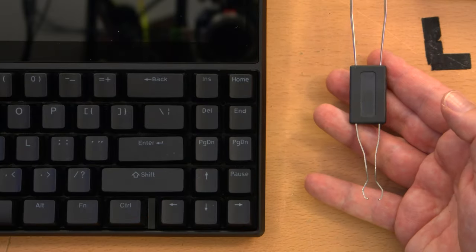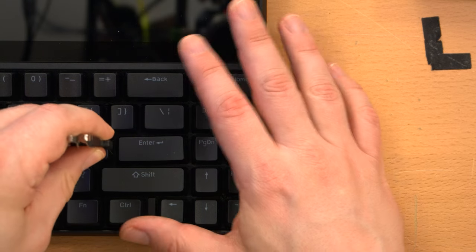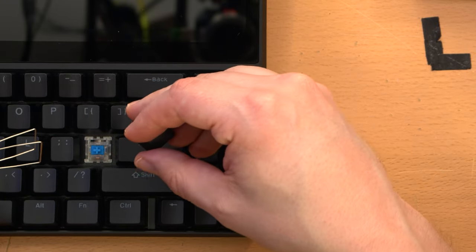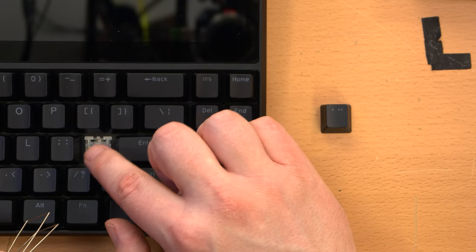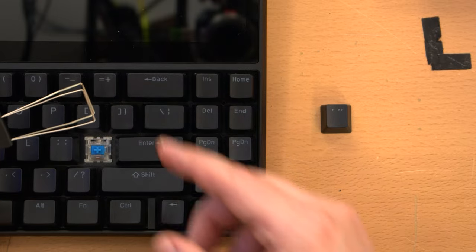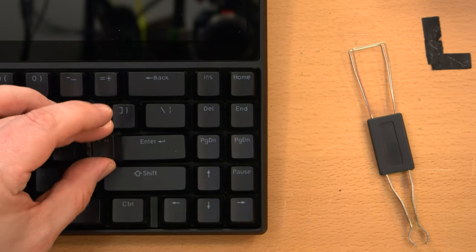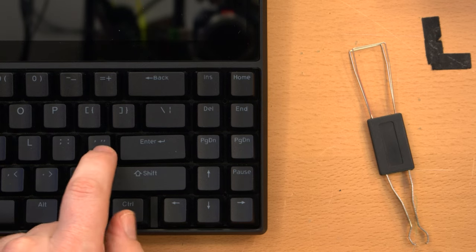Speaking of the keys, it did come with a key-cap puller, which is convenient if you're going to be swapping out any of the key caps or cleaning underneath them. The keyboard has blue switches, which offer a very light clicky feel. To use the puller — it's a very flexible piece of metal shaped to go around the key — you just slip it over the key, it catches, and you pull straight up and the key cap pops off. Putting key caps back on is just a friction fit: position the key over the shaft and press down. Voilà — key back in order.